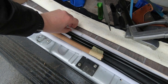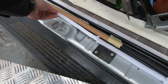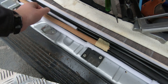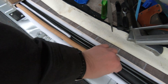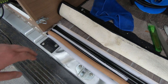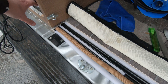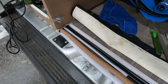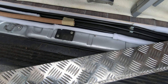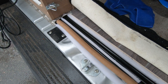What I have done: originally it looks like this - it's open, you have the insulation to the floor but you can see the body of the car which is really cold in those temperatures, very close to the water pipes. So I have put down some insulation along there, and as well at the outside because where you have this lock it just opens up there under the aluminum profile, so I have put some insulation under there as well. I have also separated the LPG pipe that runs here to the kitchen and to the cooler. Be aware - I just took a saw and cut this aluminum profile to not disintegrate the LPG storage compartment which is sealed, and it's very difficult to get this profile out without removing a lot more things, so I just cut it off.